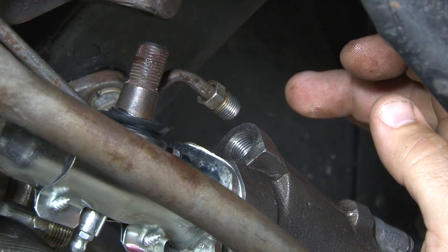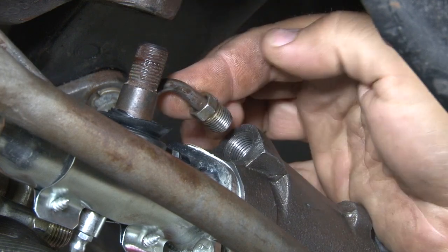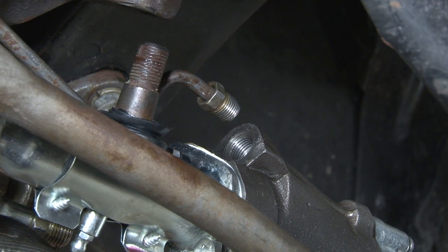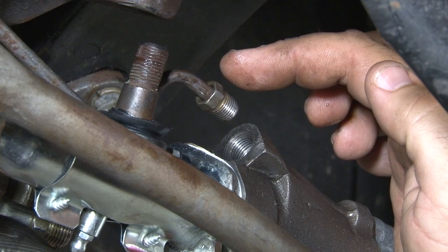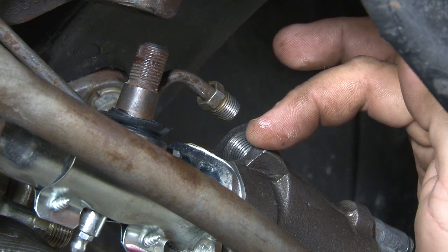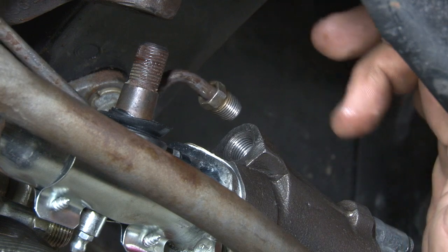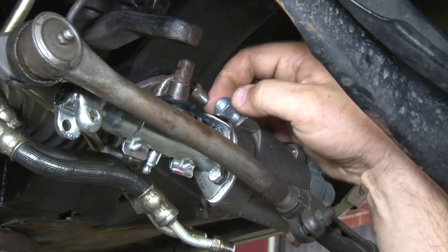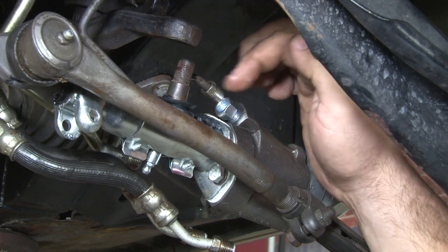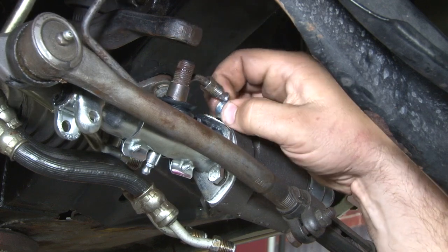As soon as we went to connect our first power steering hose, we saw an obvious issue — the fitting from our hose was way too small for our control valve. What this means is actually not a problem. This control valve is designed for a 68 through 70, but it'll also fit a 67 when you use an adapter. This line is the smaller line used on a 67, so all we need is the adapter available here at CJ Pony Parts — we'll thread the adapter in first and thread the line into the adapter. If you order the 67 control valve that we sell, what you'll basically get is this 68 through 70 with the fitting included, but the fitting is also available separately.